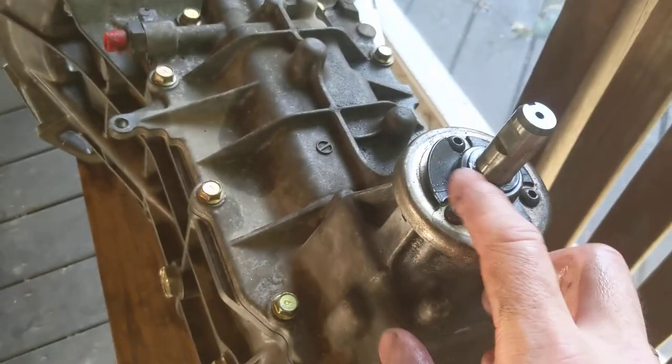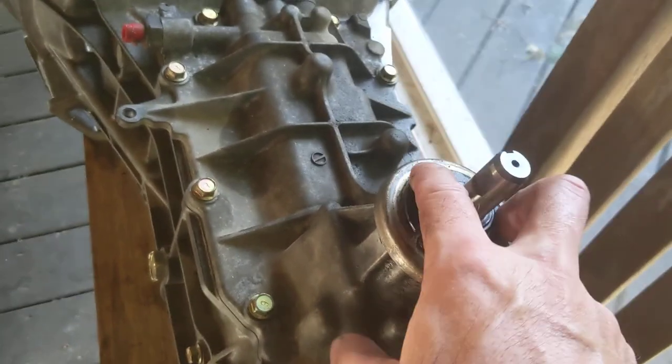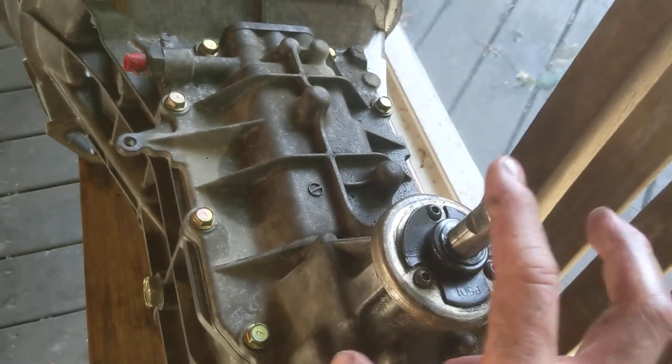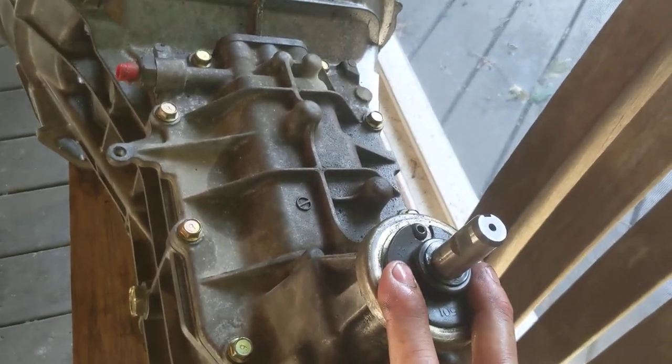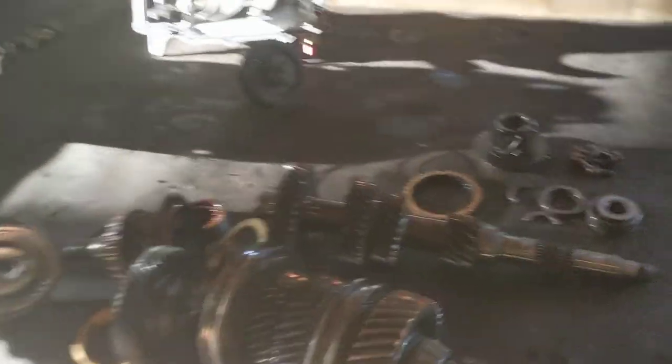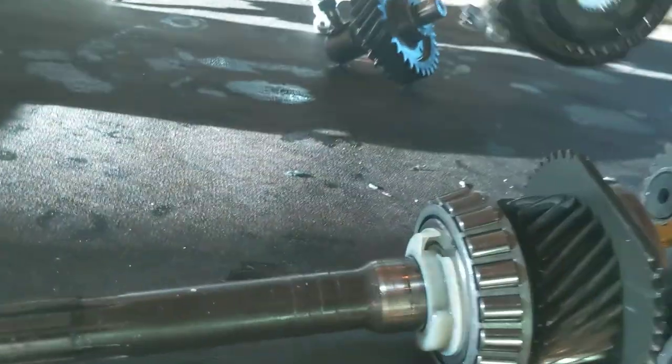And there's also a kit up here because there's a ball retainer up here that breaks. You take off these three screws. You can do that from inside the cab. If the shifter's all loose and funky, you have to replace the ball and two pins that are underneath this plate. I won't show it to you. There's lots on how to do that already on the internet. It is the number one failure mode for this transmission.